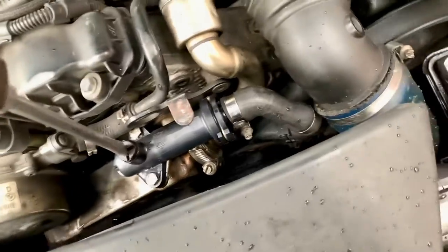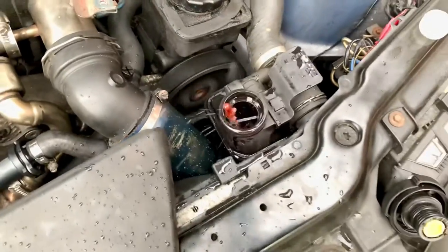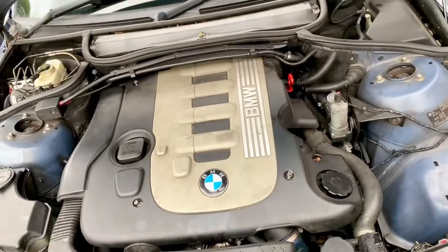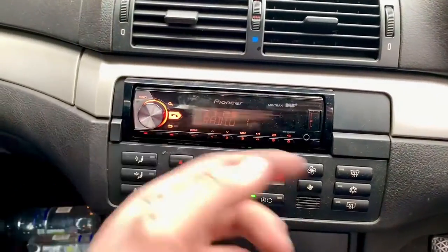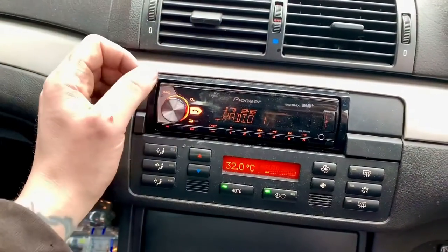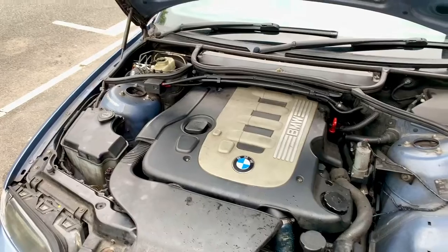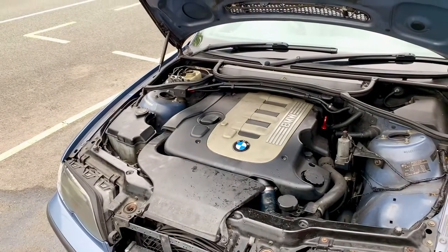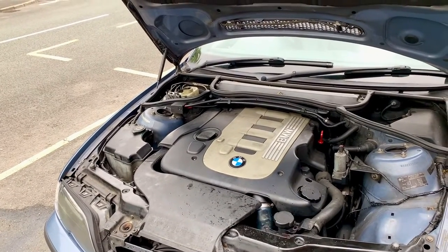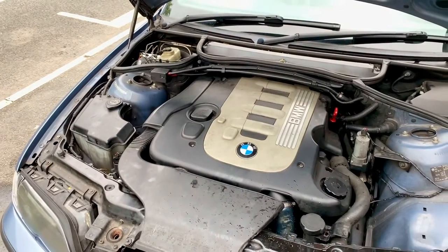Leave that venting for a little bit until it's fully bled and you're satisfied. Just warm it up and make sure the heater works and everything, then we can put this back on. When it's bled up and running you want to put the heater on hot so then the valves are open and it can circulate around and enter the matrix. Unless I have any issues like the heater doesn't work or it spits water out everywhere, that's it for this one. Like I say I'm going to do another video where I flush the cooling system - I do apologise for how long-winded and boring this one's been. Don't forget to check out my other stuff, it's not as boring, and I'll see you next time.